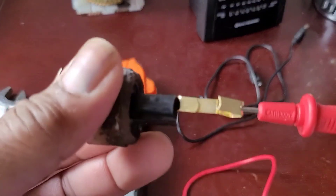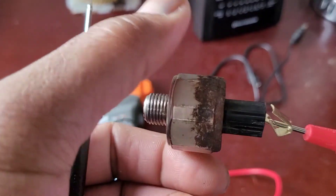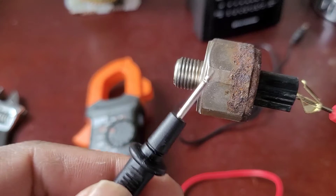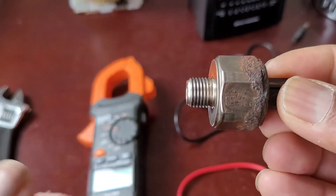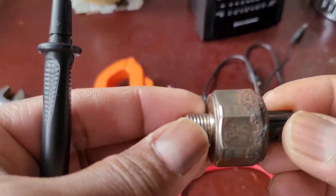If I just put the pin in I may not get a good touch on that lead, so that's why I have this to keep it in place — a bit of problem solving. I'm gonna use this end to put it on any part of the body of the knock sensor. This can be done on the car, but because it's in a very tricky place, I'm doing the testing outside.